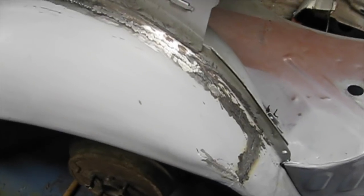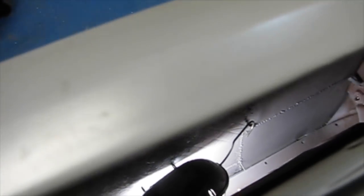I'm not going to bother grinding down these welds — I'm going to keep the strength there. But I've ground these down somewhat, kind of where you look in the trunk and see it in this area. Now I'm going to be priming the welds on the inside here with some epoxy primer. Another thing I'm going to do is take the internal frame coating and spray it into that seam. I want to make sure it's soaked in as much as I can, because it's a folded-over metal seam. I have the weld-through coating in there, but this will be my extra.